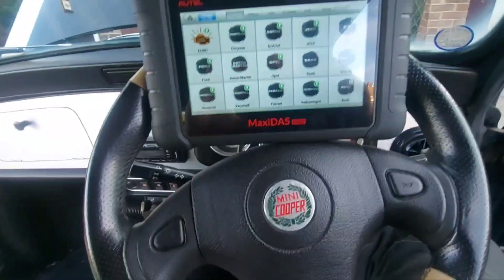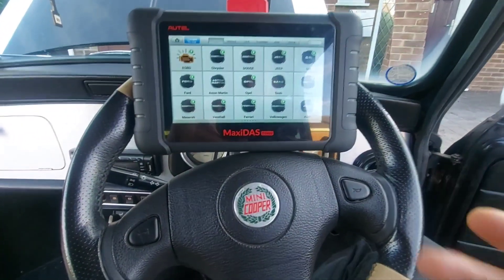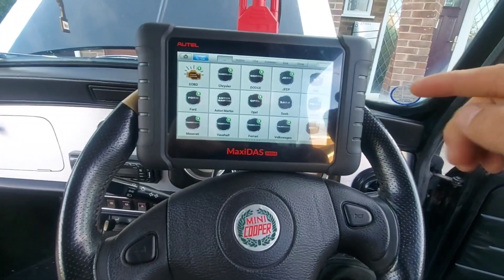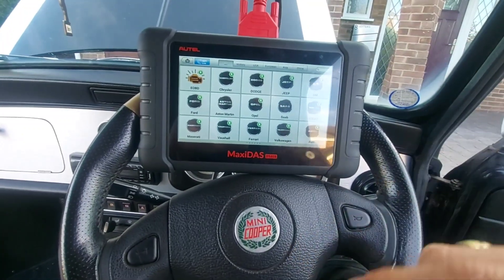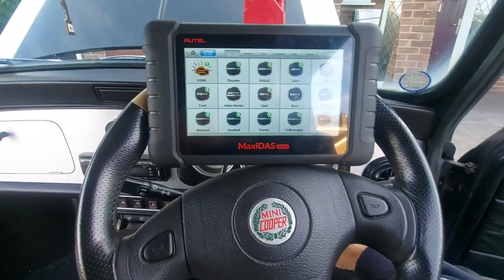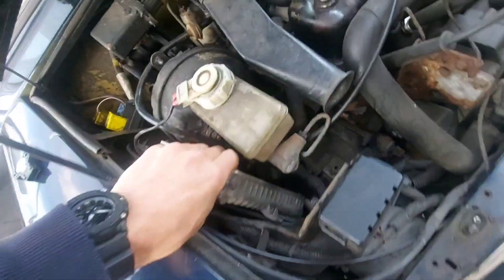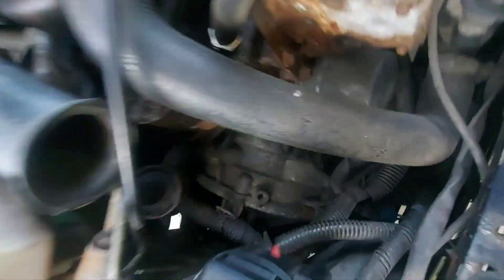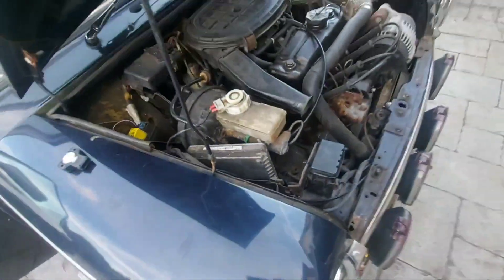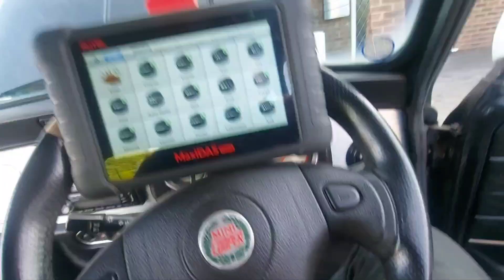Right, so I'll talk you through the story. I came out here and got told the issue — the pins on the ECU where they connect to the vehicle were actually quite badly corroded. I won't remove it now but this is the ECU, and there was green corrosion on the pins, so I cleaned those and connected it back up.